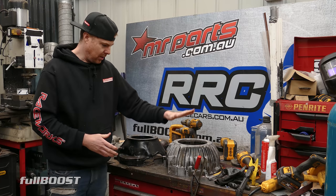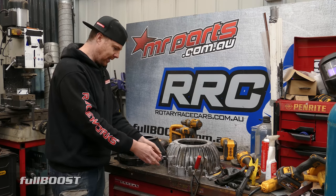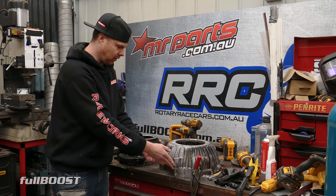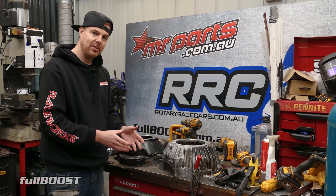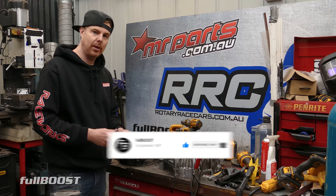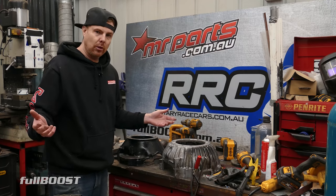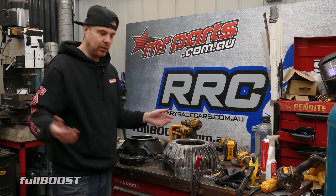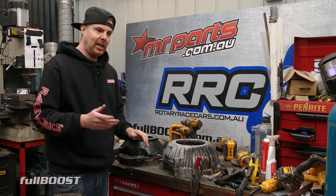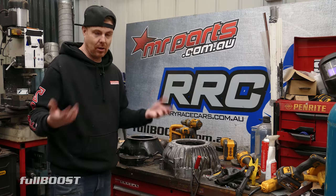The main issue is the FD - the way it mounts on an FD, and same as a JC Cosmo - the rear plate of the actual engine also has mounting for the auto starter motor. So not only do you have to run the auto bell housing, you also have to run a rear plate with the provision for the auto. I could get an FD rear auto plate, but first I'd have to find one - even brand new that'd be about $1,500, used maybe $600-$800. And if I go with a billet engine, I don't think any manufacturer offers the auto style mounting plate for a billet engine.